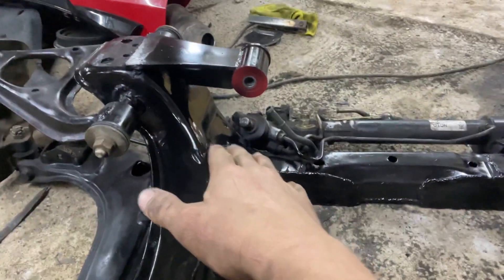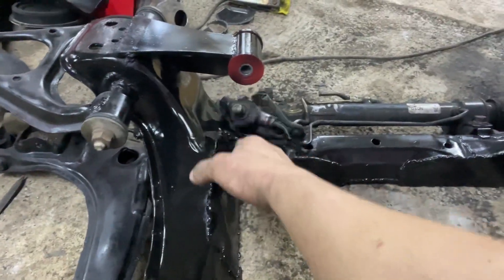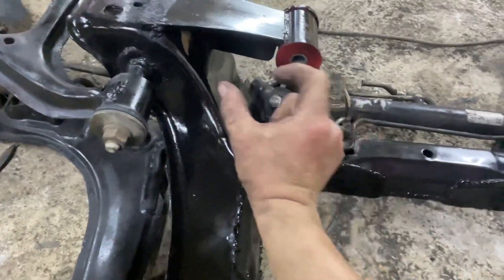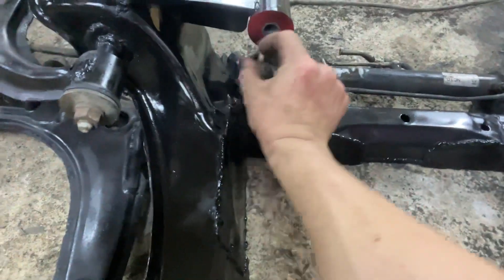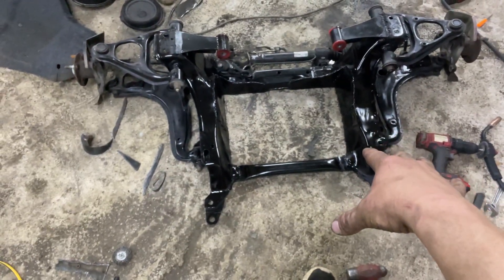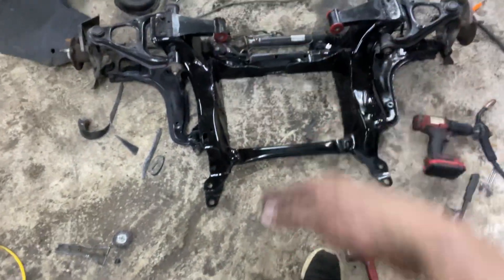The aftermarket ones are a little bit closer to the passenger side to clear the rack. But what I did is I made sure at this height with the 16th of an inch and the way I cut this angle here — that allows it so when the actual swivel part of the shaft is there, it clears it by like that much. Everything clears here, and the reason I notched this out is actually to allow the headers — the exhaust — to go down and clear.